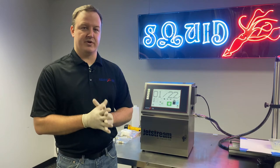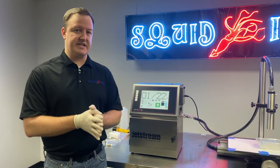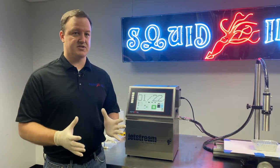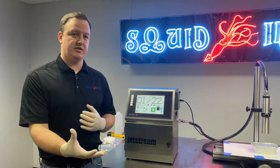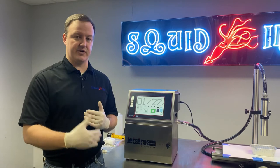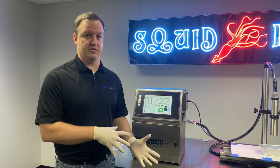If you're curious whether or not the printer needs a PM — preventative maintenance service — there are a couple things we can look at. The Jetstream only needs a PM kit once every 6,000 hours of actual runtime. If you're not sure where you're at within the 6,000 hours, you can just let the printer tell you. When we're within 400 hours of that limit, the printer will give you a notification to schedule preventative maintenance. The closer you get to 6,000 hours, the more frequent that reminder will be. When you meet or surpass 6,000 hours, the printer will always remind you, but it's not going to shut down — it'll still let you use the machine.